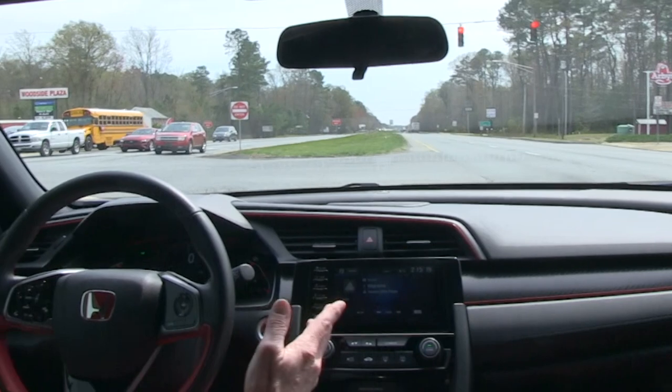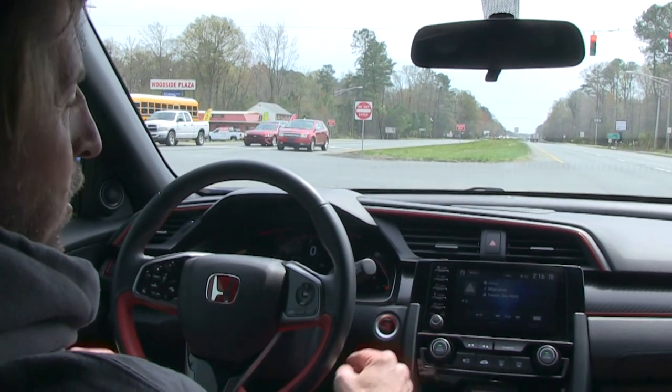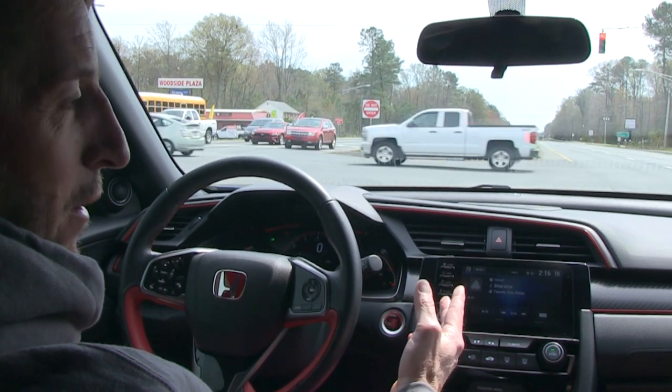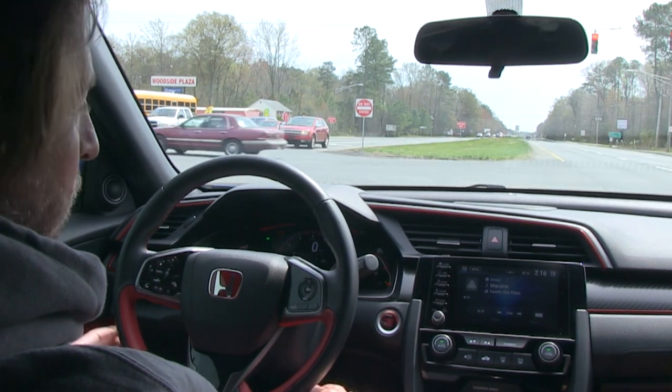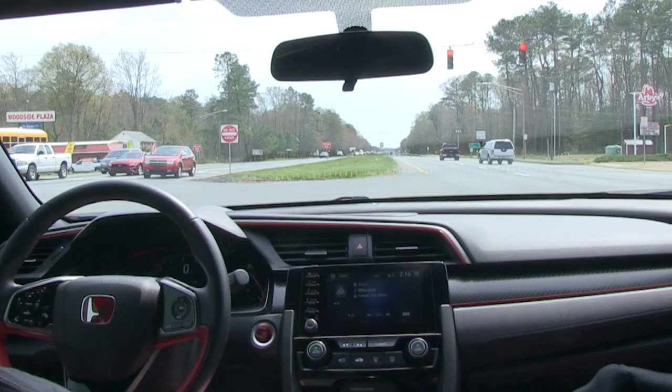Right. So we didn't pump up any more horsepower. We just made it breathe a little bit easier and keep the cooling down for the turbo, so turbo heat soak isn't as bad on the motor. Absolutely. The extra air cooler helps out with that. The oil cooler helps to keep it cool. So all the things we're doing are really helping to prevent it from having a warranty issue.